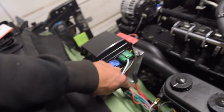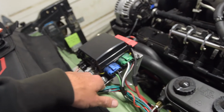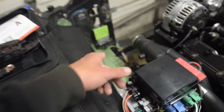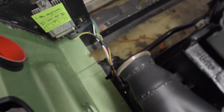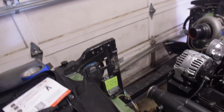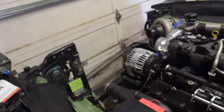So basically I have everything that needs to come out to the engine bay run from inside the car, and my outputs for each of the relays run down and to the front. So everything is secured down here, and we've got our lights and horns and everything out the front of the car, so I'll do that when I start to get the front put back together.